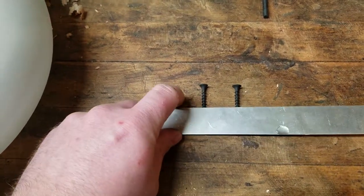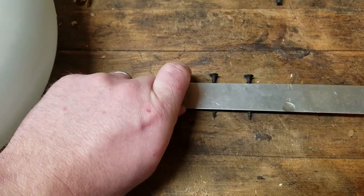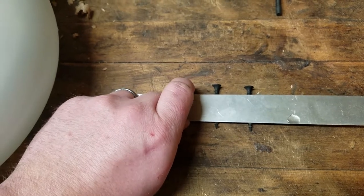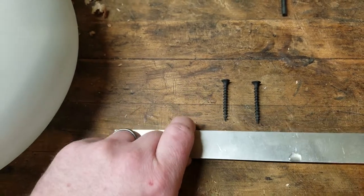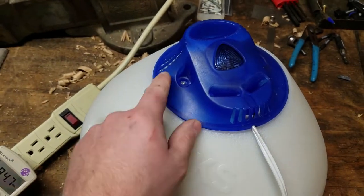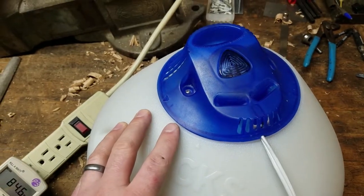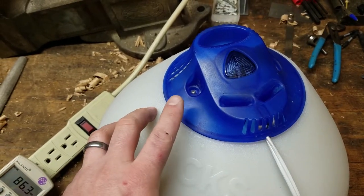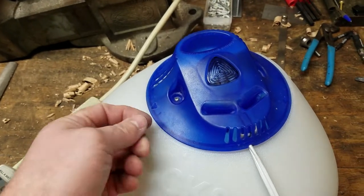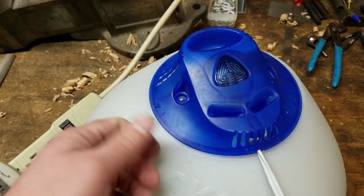It's kind of an ingenious system. I always love these little simple mechanisms because it's kind of foolproof. I'm guessing they have a max level because if there's too much water in here, you're having a lot of current flow through and that might damage the circuit. The only thing I'm a little worried about is the screws I replaced to hold the carbon rod in place — given water, and if we put salt in here again, those could rust out prematurely and the carbon rod could fall off, in which case it stops working.